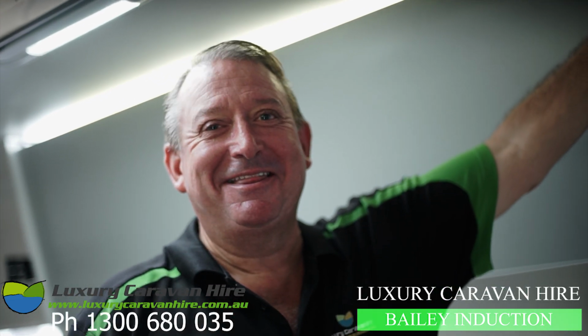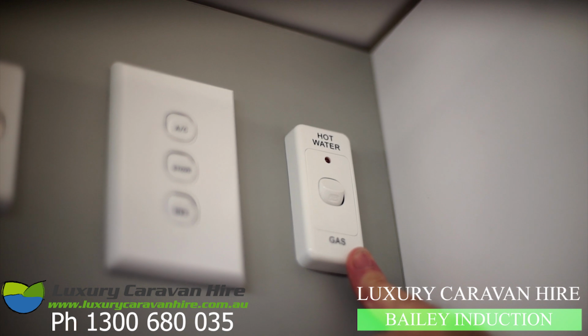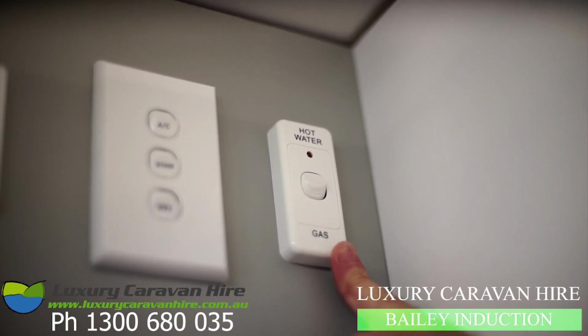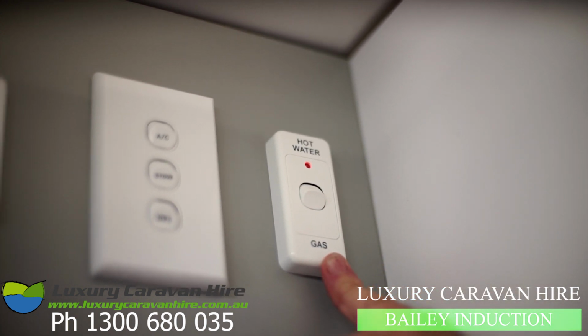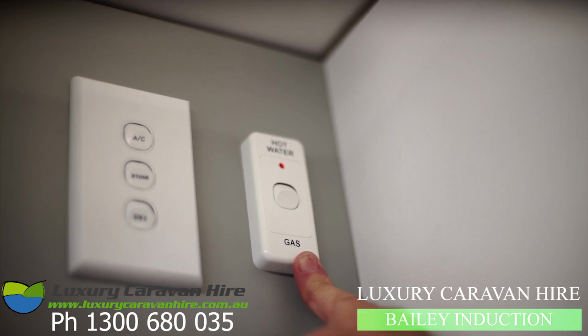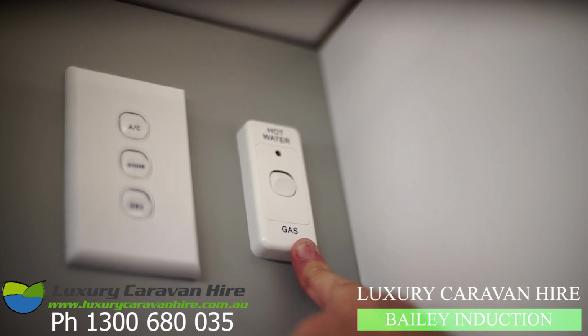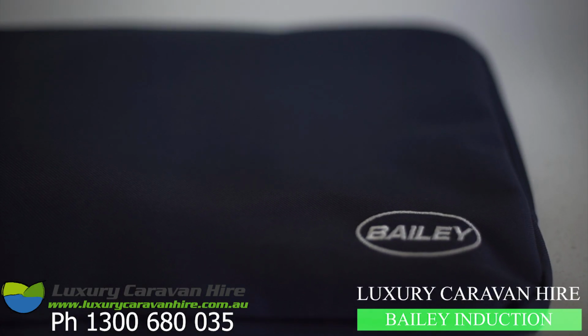So you've got your switch panel here, which includes the isolation switches. We've got our hot water system operating on 240 volt. If we need to turn it to gas operation, we'll need to switch the bottles on at the front, open the taps, and then switch the switch to gas. Now we know that we're operating on gas hot water rather than electric hot water, and the system will switch over seamlessly. If you need the instructions, they'll be in the compendium of manuals.